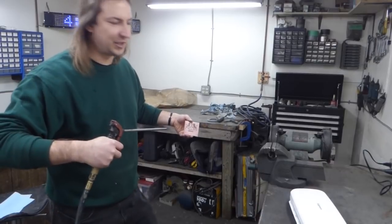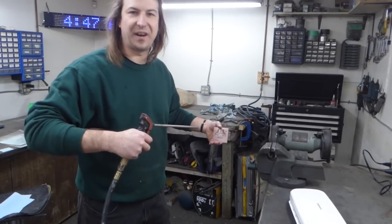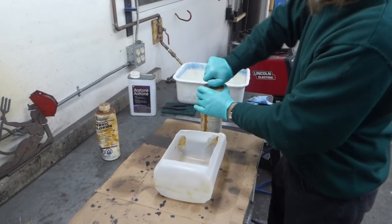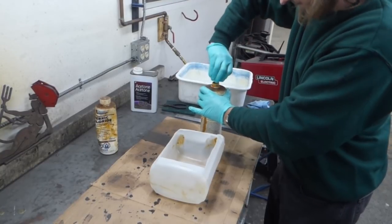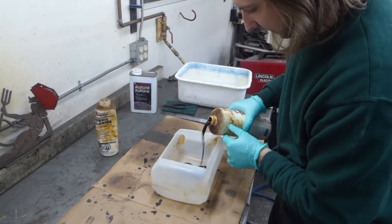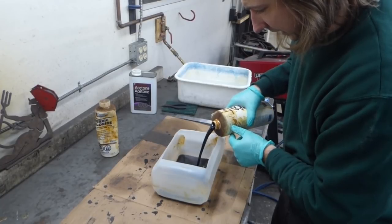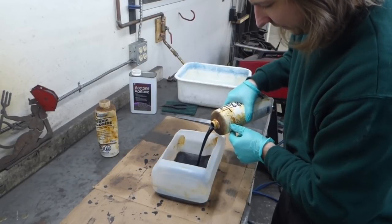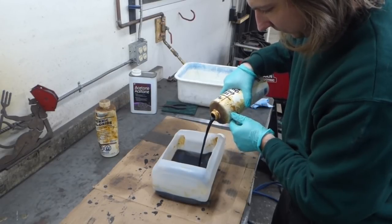Now the laminator I'm using right now isn't actually as good as the one I normally use, but I couldn't find the one at the office on Friday, so had to go with that one. And I like to etch my circuit boards with ferric chloride. This is nasty stuff. It's very corrosive, yet it's never actually bothered my skin, so really the only reason I'm wearing the gloves is because of the staining. This stuff has been the ruin of many of my clothes.